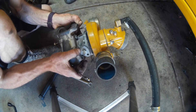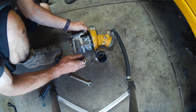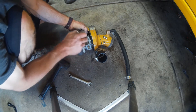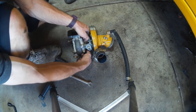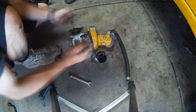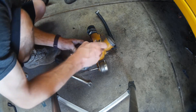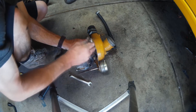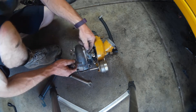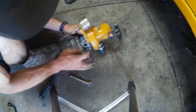Another little trick I like to use: sometimes you'll have a bolt that comes up underneath an oil boss, a water boss, or the drain, and you can actually use the bolt almost like a lifting jack to push the center section out of the housing once you have all the bolts loose. Right now they're all hand tight, so by pushing this up I'm actually separating the housing from the center section. I'll do the same thing on the back — just evenly use this to push the housing out and it will eventually pop out. And it looks like we're already free.